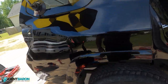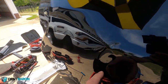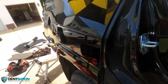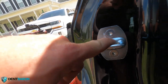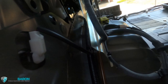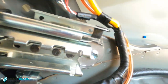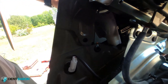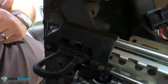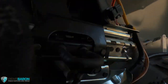Going through the grommet through the taillight is pretty much non-existent unless you take that trim panel out — and by the time you do that there are so many other ways to get access to the dent. This takes about eight minutes total to get the seat out and trim panel out. Totally worth doing — you can charge the customer for it because it is an R&I procedure. Going through the striker plate is not gonna happen either: there's a seat belt retractor in the way plus a reinforcement mount. No tool is going to fit in there on this particular one — I believe this was a 2019 Toyota 4Runner.